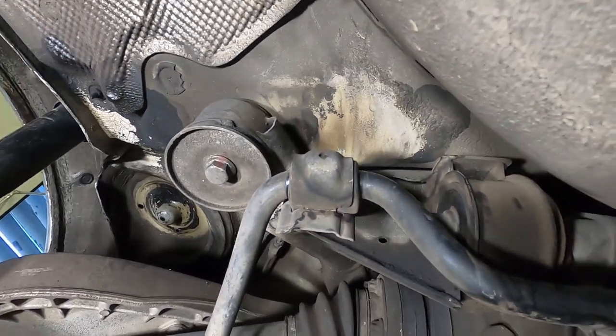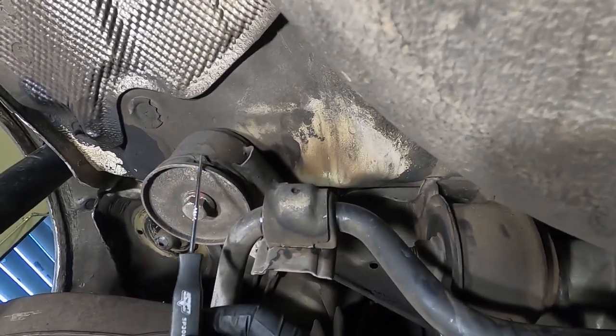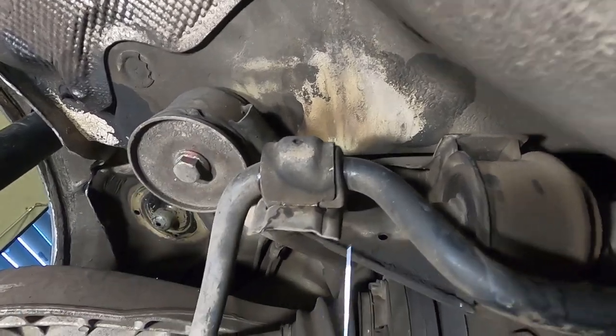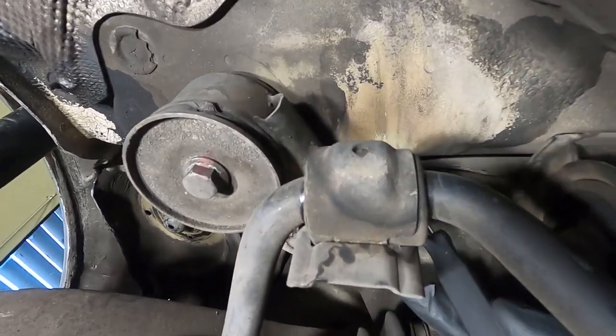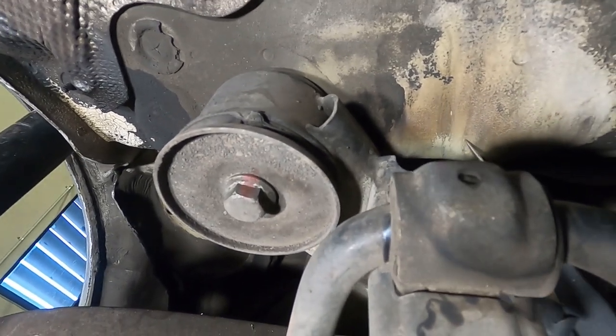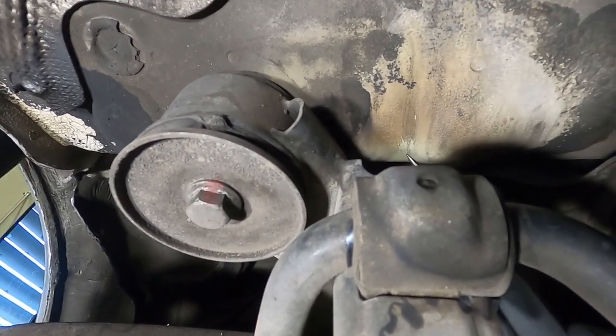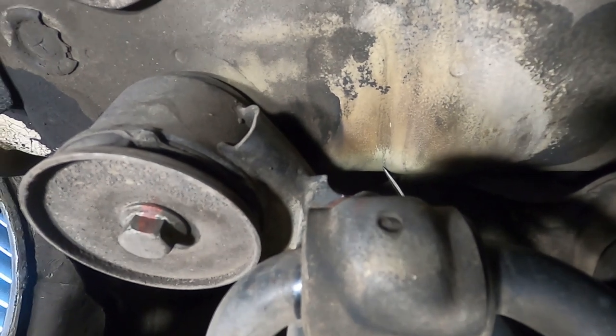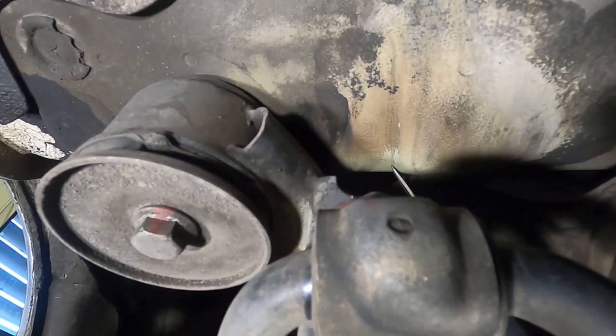All right, so looking at the rear left subframe mount, you don't actually want to look at the subframe bush itself. You want to look inbound in what's called a stress riser. So the kink here between these two faces of the carry panel where there's a fold is generally where cracks initiate, right on that edge there. You can see the pick tool rubbing on now.